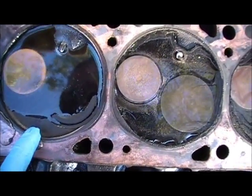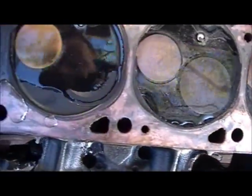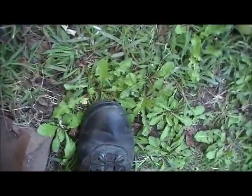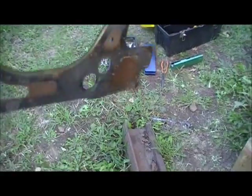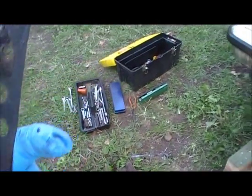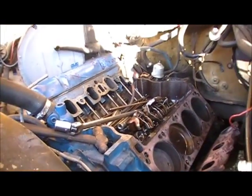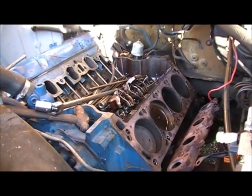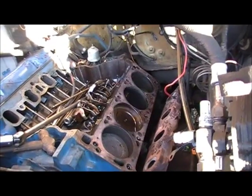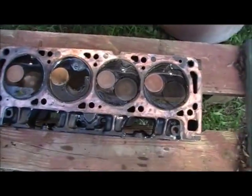I'm going to go ahead and pop the valve out. Probably do a replacement and lap it in. After that, all the other valves look like they're in good shape. The head gasket was in good shape — no evidence of leaks. It had sealed just perfect. This is a Felpro gasket. All I need is a set of exhaust manifold gaskets and a head gasket — it's a dry intake, it doesn't need intake gaskets, it has a special pan. I'll get a set of carburetor gaskets and an oil change. After that, it should be good to go — road ready again.